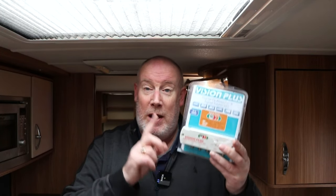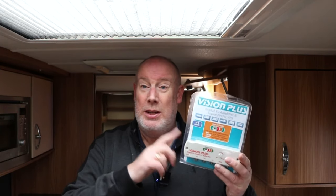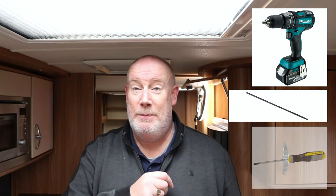This is just a straightforward swap from the V2 to the V5. You're disconnecting your old one and just replacing it with this one. You don't need to mess with any feeding wires through. So this video is just for people that want to upgrade to this from a V2 or a previous model. So what tools are you going to need? Well, you're going to need your drill, a 3mm drill bit, and a posi screwdriver, or a Phillips, whichever you want to call it. Some people call it posi, some people call it Phillips.